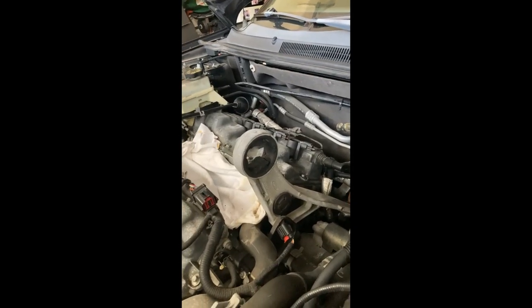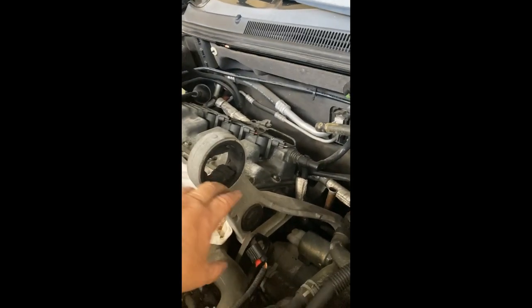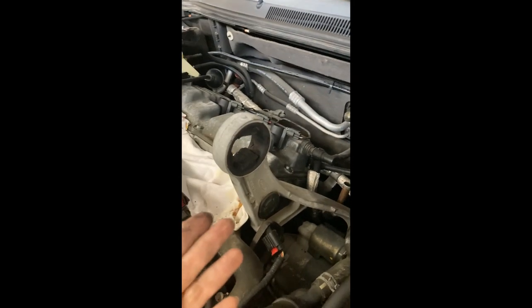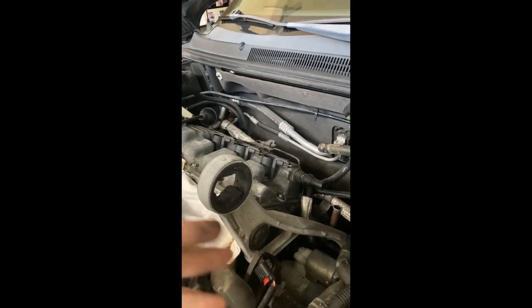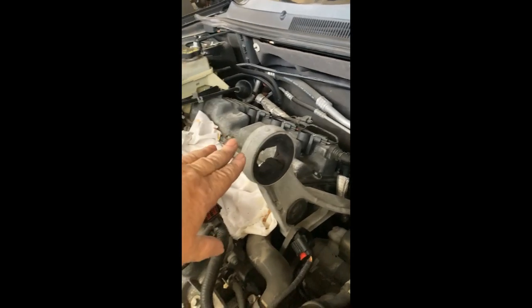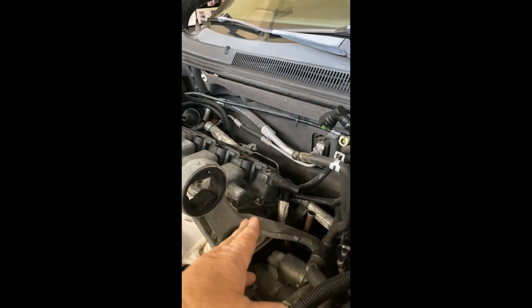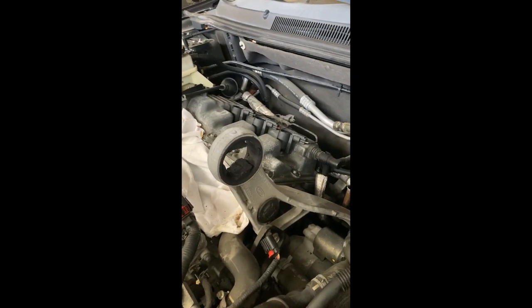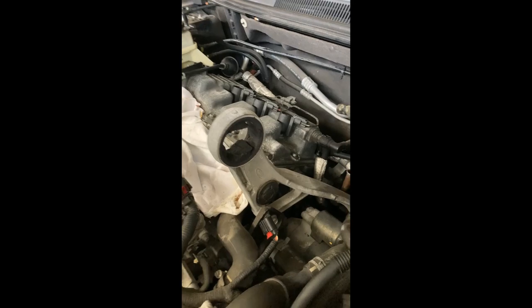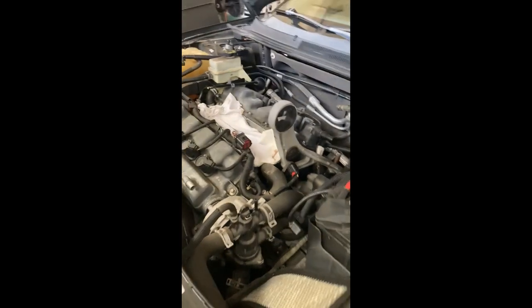And the only other suggestion I can make is if you already have all this out, it's the time to go ahead and take care of this because you have so little wiggle room here. You might as well do it while everything is off the car. If you don't have that option like I have now, then just leave the intake manifold on it and just remove the throttle body from here. So that way you'll have some space to work with. But other than that, we'll see what happens. I'm going to try to replace this. But that's going to be in my next video, so keep an eye out.